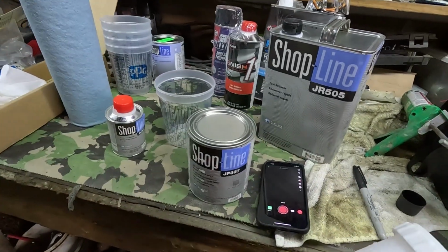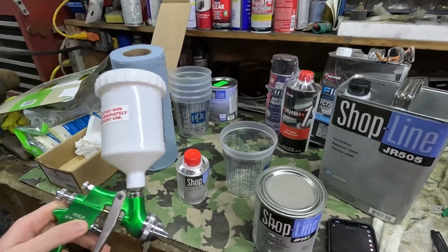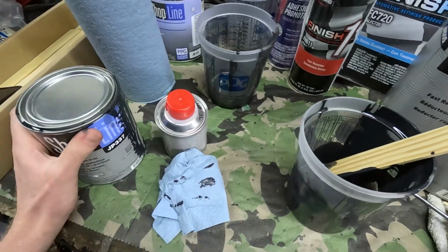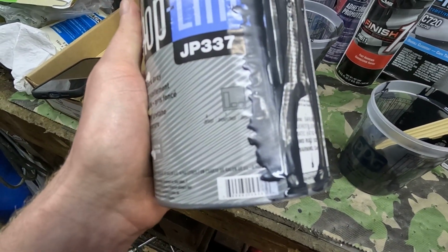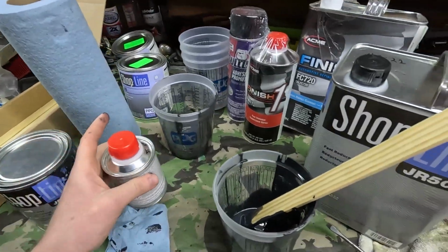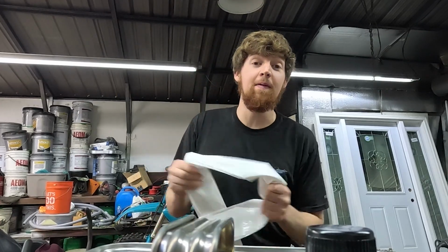I got the phone over here. I'm in the middle of filming some TikToks too. I'm gonna get this open, figure out what mixture we need, and we'll jump right back. We're back. This is already getting messy. We got our first mixture of sealer. This sealer called for 4 to 1 to 1. So we mixed 4 parts sealer, 1 part hardener, and then 1 part reducer. I can't forget my painting attire, a rain poncho. That's gonna have to do for now.